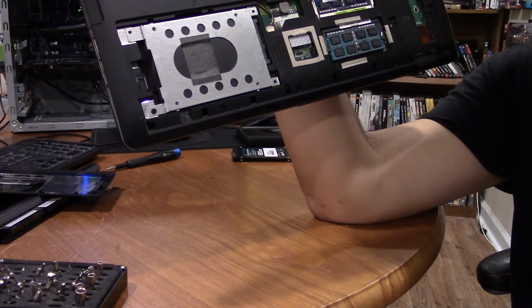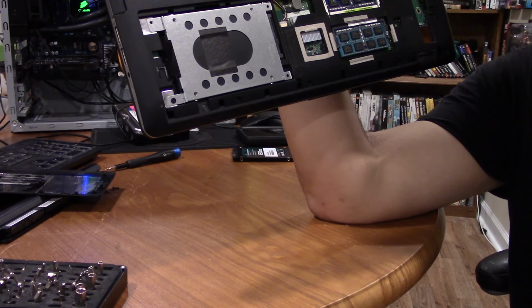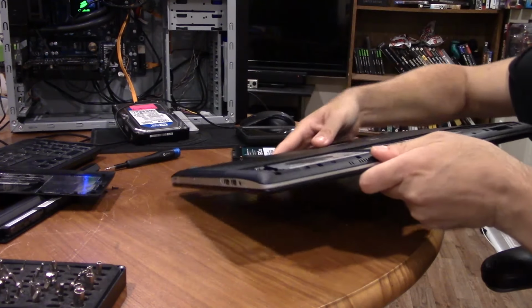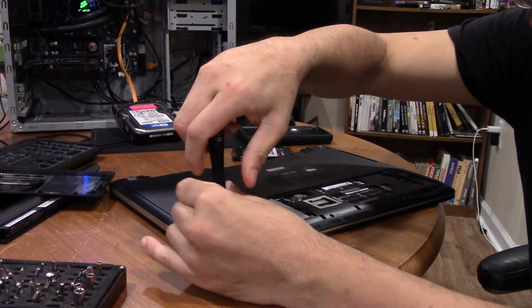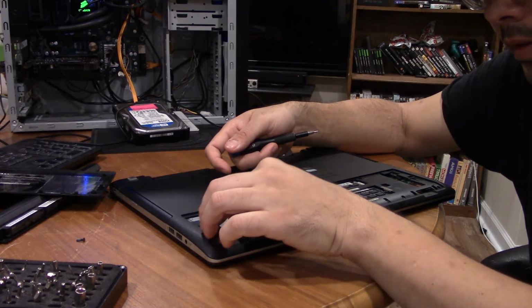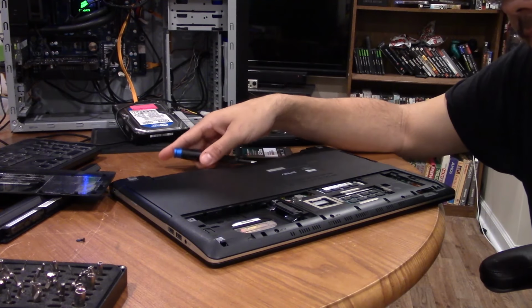You'd have to follow it up underneath the cover, and right there is your hard drive. It is a mechanical spinning hard drive right now because I was down to 1 SSD and I didn't want to sacrifice it just for the laptop, but now I have extra SSDs again, so let's go ahead and remove this drive. Now, some computers do have the availability to add an SSD or an NVMe or an M.2 underneath it. This is not one of them. It's a little bit older, but as it is, I'm happy with what it has.